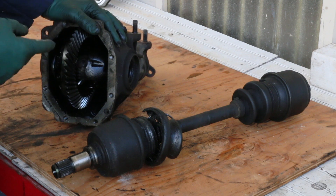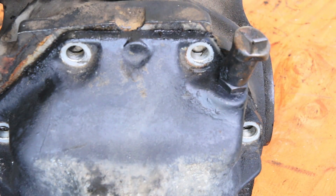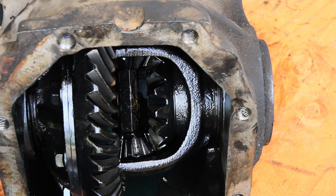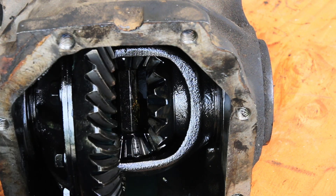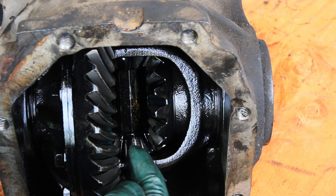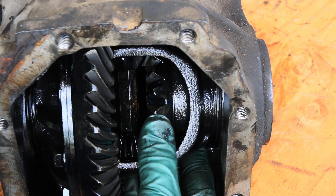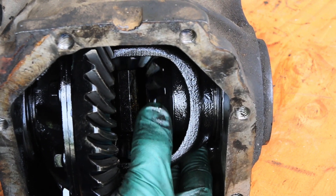It's really important that I show you what might happen — this is very, very rare, but when you see this you're going to remember to check it any time you're having any kind of weird rear-end clunking sounds. This is what the rear cover looks like, and it can be removed to inspect the gears inside. The ring gear hardly ever gets excessively worn — like I said, they're very strong. Here are your differential gears.